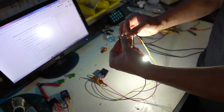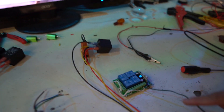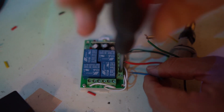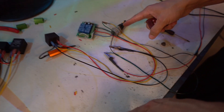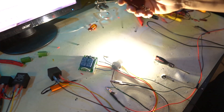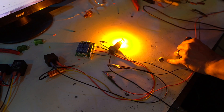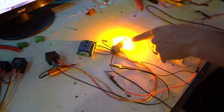If I really wanted to add an extra function or have this thing set up with a switch panel or something like that, I could absolutely just take this wire here — which is going to be the power for our turn signal circuit — and hook that up to a switch. So let's show you exactly what that looks like. If I use a four-channel remote control — a very basic four-channel remote control — it's got power and ground coming in and then power looping to all the different little connections. I'll hook up the power and ground to the remote control, and then the power wire going to our flasher relay hooked up on channels one and two. If I want to turn on white, I'll turn on channel two; if I want to see the turn signal circuit, I'll turn on channel one and that goes through the flasher relay.